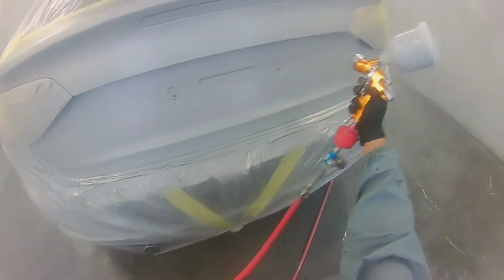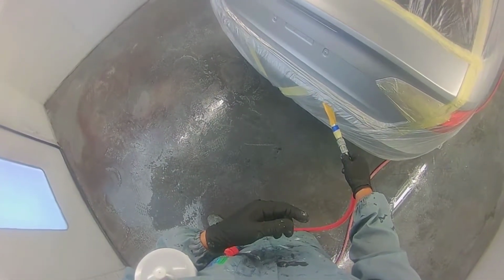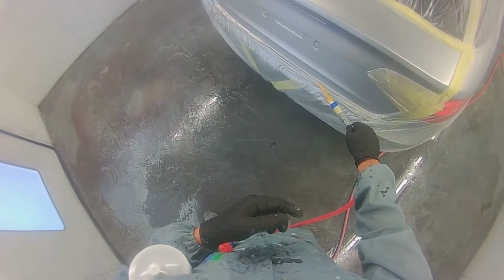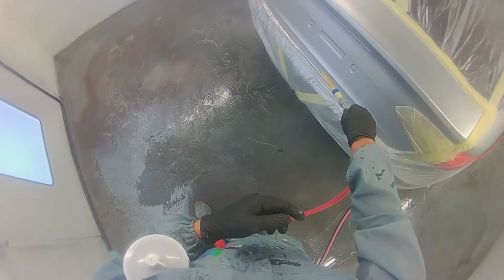But even on the first coat, as you can see there, I just eased off because I noticed some silicone towards that left lamp and towards the bottom of the tailgate where the repair was, where I put some wet and wet primer and some fade out agent, which I think some thinners maybe have blown out from the rear lamp and probably caused some silicones. But there was nothing to worry about.